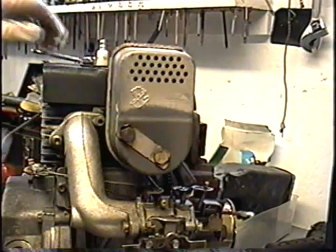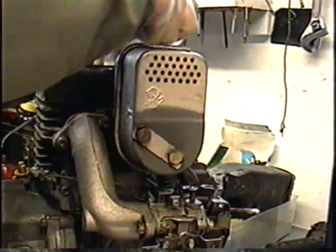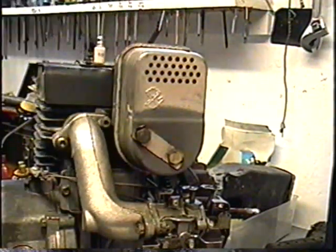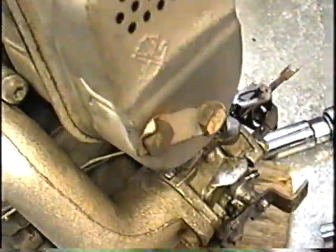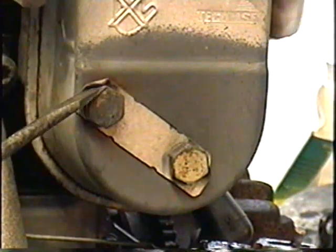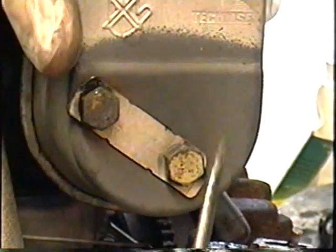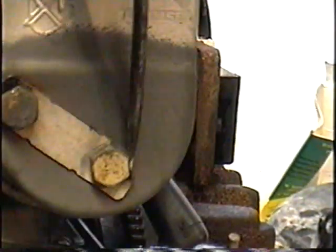The muffler is still in very, very good shape — they cost around $50 here. There's the 3/8 bolt up top of the engine that holds the muffler, and then there's the two half-inch bolts to remove the muffler completely. On these mufflers, you need to retract the small clip — a piece of metal that's bent over — that stops the bolts from getting loose on your snowblower. You can use a hammer and a flat screwdriver and just tap them out.